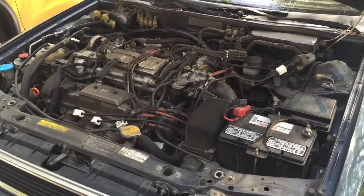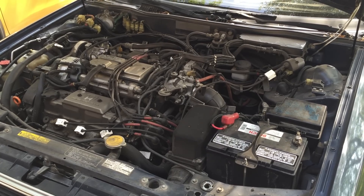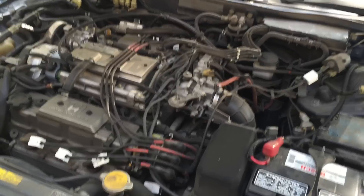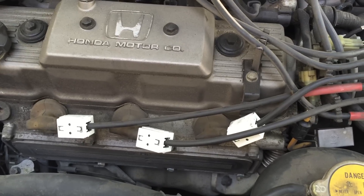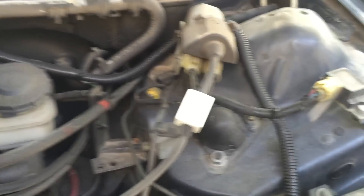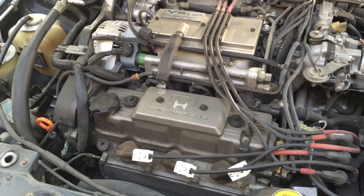Because this is an older vehicle — a 1988 Acura Legend — I've probably managed to avoid some of the problems people have with more electronically sophisticated cars. However, this car still has an ignition system. After reading some forums online, someone had suggested using ferrite beads on every single spark plug wire connection, which I've done here as you can see. That probably hasn't done anything noticeable — I can't tell that this has made any impact at limiting the electrical noise.